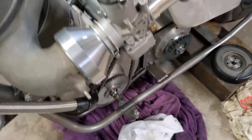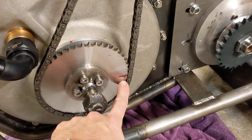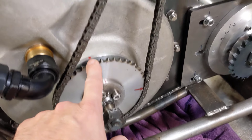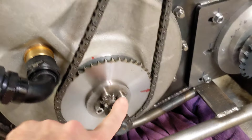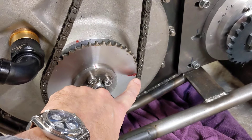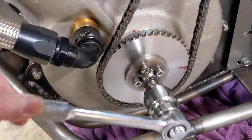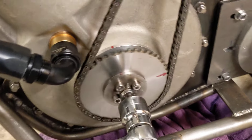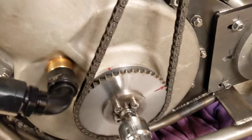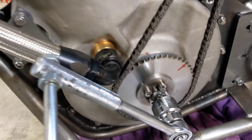Now that would appear to be great news. We've marked it here for top dead centre — there's the red mark for TDC, and there's where the conrod is. So when these two line up we are at top dead centre, and we're probably about on compression at the moment. Yeah, there's compression. So we bring it up to about there and then give it an almighty kick, and at the same time energise the Dynastart.